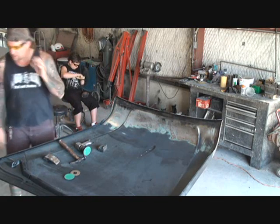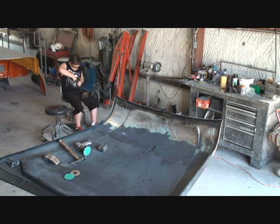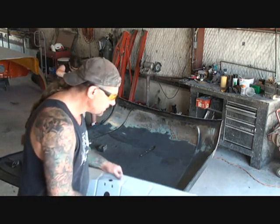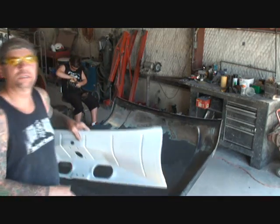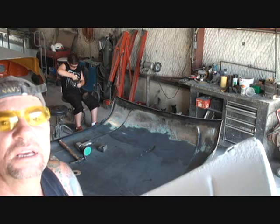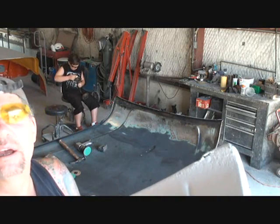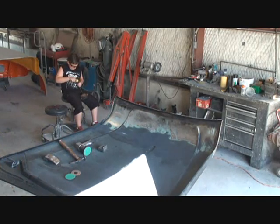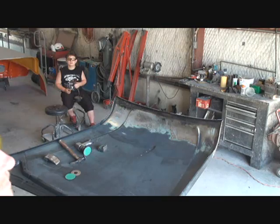Okay, we got that piece done. Now what I'm going to do, while that's drying, I'm going to go ahead and cut this piece out right here. I'm going to cut this section out where you can see where it's rotted. I'll cut that section out, make a new section, and weld it on there — get it all fabricated. We're going to paint the inside of this, spot weld it all together, and it should look brand new and ready for restoration. Does that make sense, Trevor? He wasn't listening — he's busy working. That's good, that's what we want.